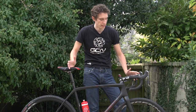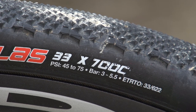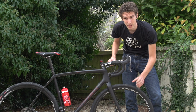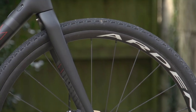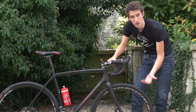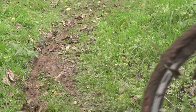Away from bike fit, tyres are absolutely crucial — far more important than they are on the road. If you're going to race, the UCI have a limit on the width of your tyres, which they run at 33mm. It's a little more complicated than that, because although all tyre manufacturers put the width on the sidewall, it does vary. It's your responsibility as the rider to make sure that if the UCI came along with a tape measure, it would come up as 33mm. For general riding and training, I use 33 to 35mm tyres — you get more traction and they're far more comfortable.